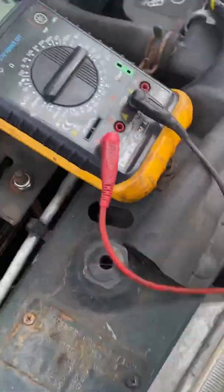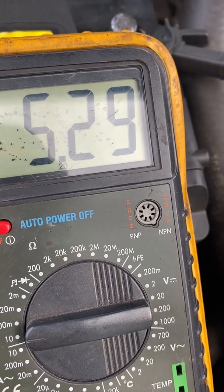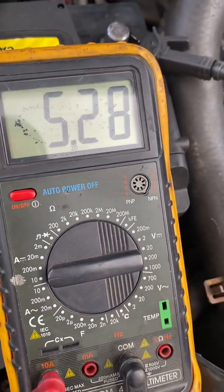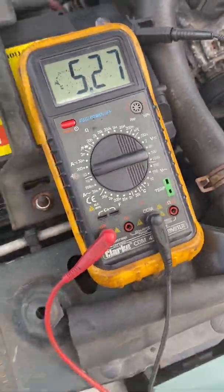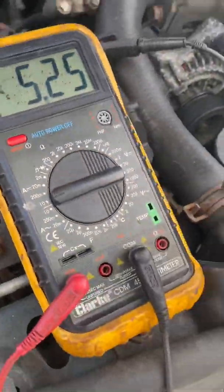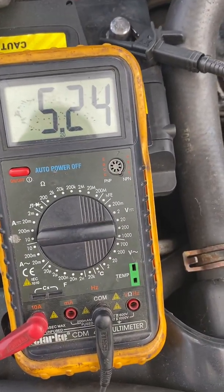So this one's got an interior light — we open the door and the interior light comes on. You can see the interior light circuits on this because it's got so many interior lights. It's probably a glove box, it's got one front, one back. It's got a lot of lamps that light up. So the minute you open the door, it's pulling 5.2 amps — that's a lot of interior lights. And then when you shut the door, you've got to wait for a while for the timer to put the lights out. But it's a good way of confirming that you are still live and making sure your circuit's all still going.